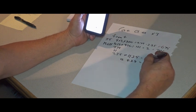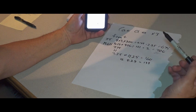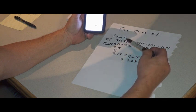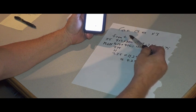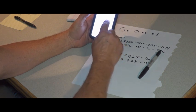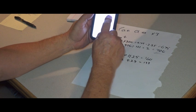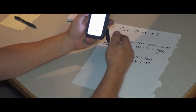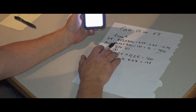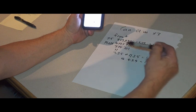Now we have to figure out how to determine the combined spring rate. The formula is: upper rate times lower rate, divided by upper rate plus lower rate. So 300 times 350 equals 105,000, divided by 300 plus 350 (which is 650), equals 161 lb/in. So we have a 161 lb/in combined spring rate on there now. We want 164 at the high end — we're really close. In fact, we're probably not going to get a closer combination, so we're happy with this one.